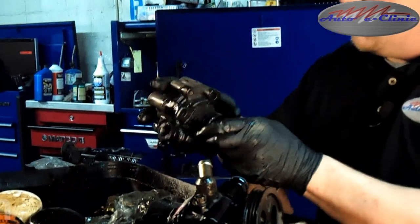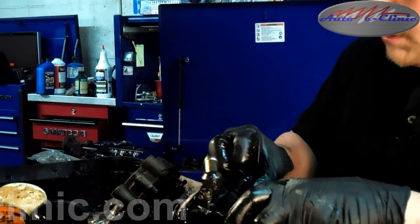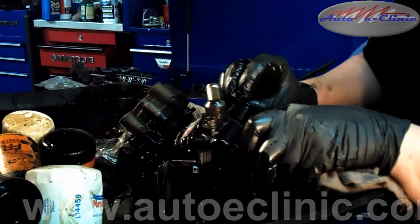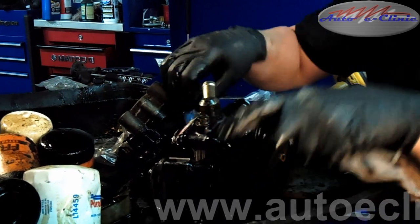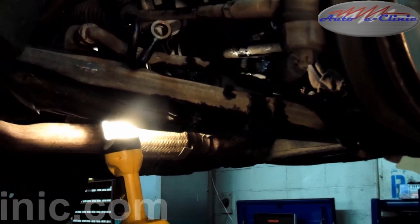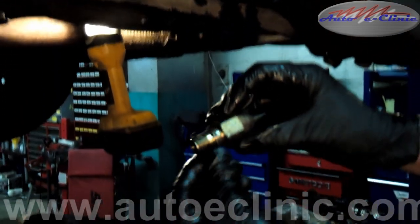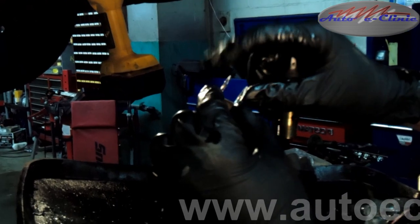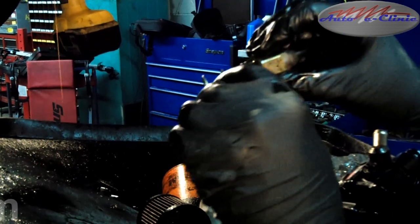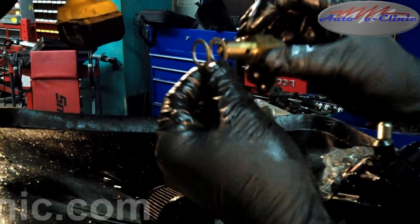Another visual inspection of the old pump to make sure we don't miss anything. While we're here, it's easier to show you with it out. Your power steering pressure line — you'll notice you've got a washer on each side, and when it bolts into the pump, this is the way it goes. These are compression washers. You're pretty much okay to reuse them — they work by compression, that's how they seal. Make sure there's one on the bottom and one on the top.